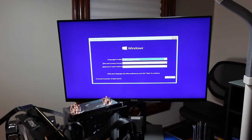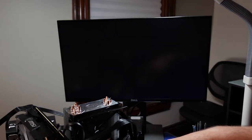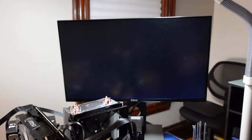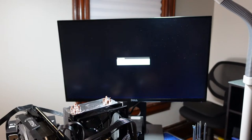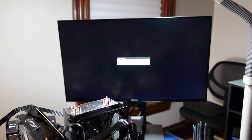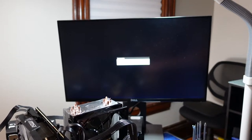So I'm in the two back, so I'm gonna move it into the two forward red ports and we'll try it again. And in the listing, it says it's using Intel Rapid Storage Technology. So the chipset's an Intel chipset, so I think that'll be what solves it. So I'm gonna move them over one.